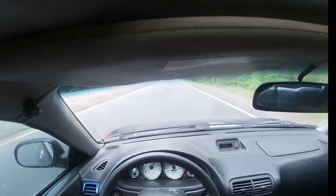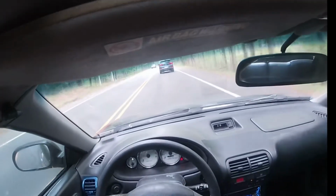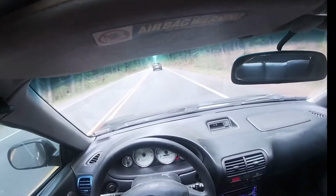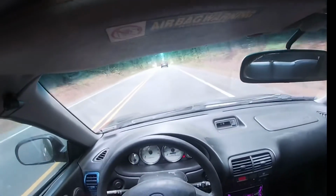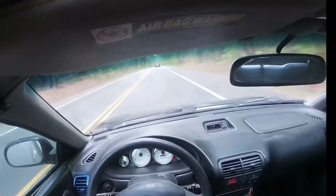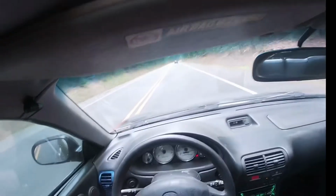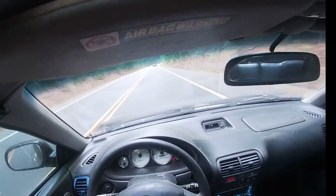Let's see. First gear. Here we go. Pushing the clutch goes down to about 1,000 RPMs. That's perfect. Let out the clutch just easily. So I'm running about 50 miles an hour, and it's running about 2,500 RPMs. So that's good. I like the idling. I like the RPMs. I like the speedometer. You know, where it's all matching good. It was really high. Before, we would go 60 miles an hour and it would be at 3,500 RPMs, which I knew wasn't right. So I think we're good.